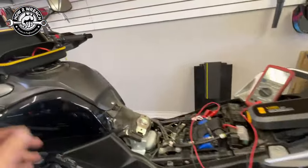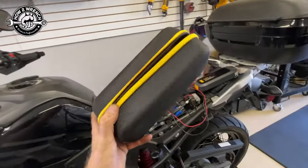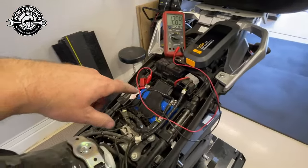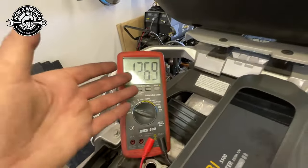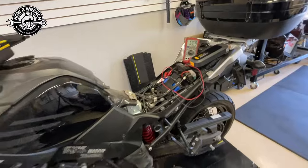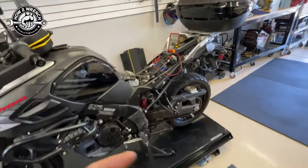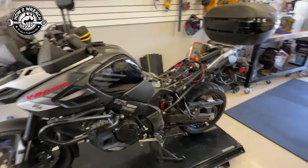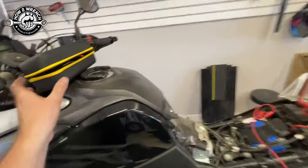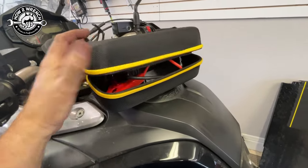What I wanted to do is create some scenarios to force this to work. I put a brand new, charged battery in my DL1000 here, and I just want to drain it down to a point where the bike won't start on its own — then that'll require this jump pack. We'll put it on, see what happens once it energizes, and see what the voltage reads.